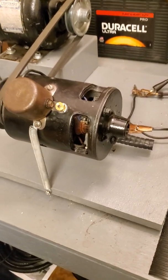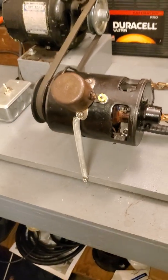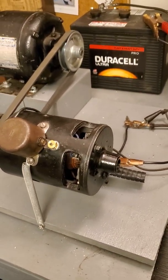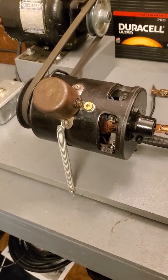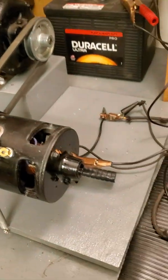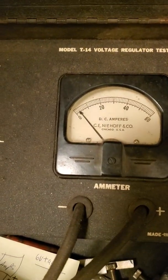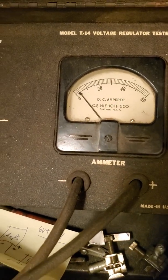So I love the LED lights. That lets the generator run continuously at its lowest setting and still provide everything it needs for any day or night driving. So this generator is set up the same way — I've got it set on its lowest setting of the third brush, all the way up. I'm going to turn the test stand on and we'll look at it real quickly here. It's running. I've got my voltage up and you can see the amperage is pretty low — only about three to four amps or so at the lowest setting.